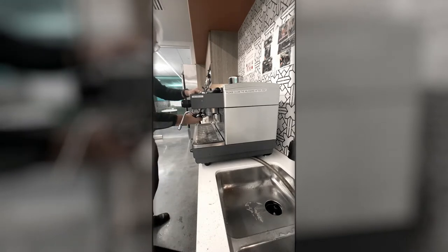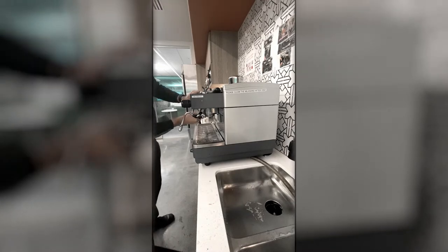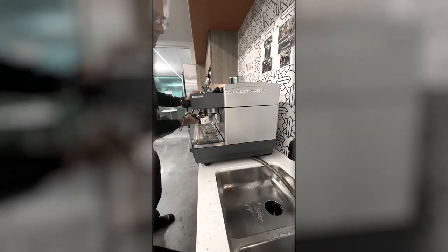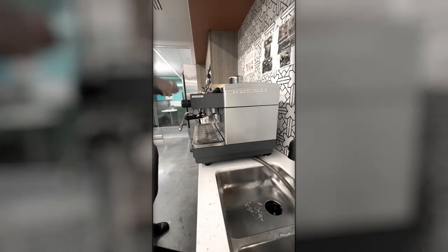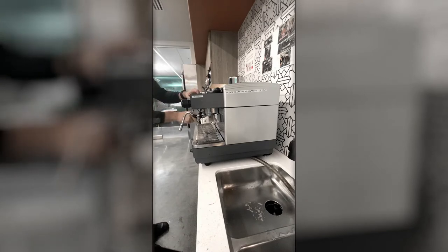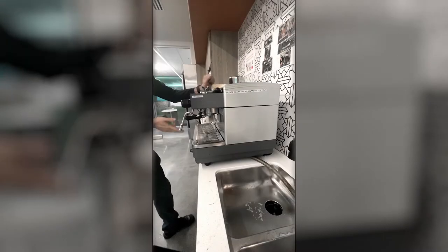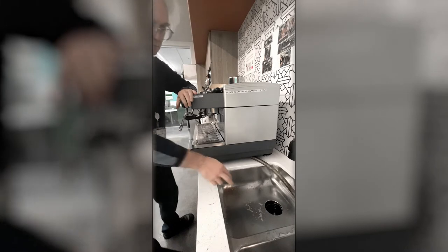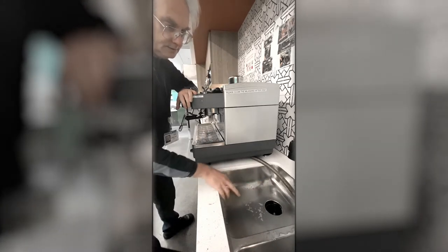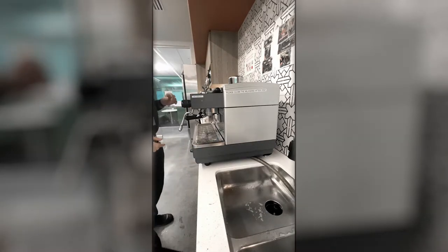Part of the purpose of releasing the pressure, opening up and back in, is that it forces the unit to reacquire the pressure and forces it back up. Rather than just maintaining pressure inside the unit, it allows the water to come in before the full pressure builds up. So we do another 10. Another count of 10. And release. Now we're seeing that there's not as much material coming out, not as much suds, not as much grit. That's telling us we're getting close to being finished.